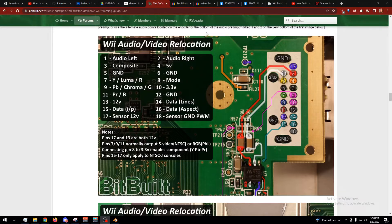If you don't pull the optical drive out like I did, it's going to be a lot harder to find space to add your audio jack. Alternatively, I hear the Wii HDMI adapter has all of the pins, even the ones that aren't used, so you could repurpose some of these other data pins — from what I understand, those aren't used for anything.